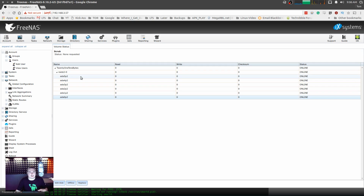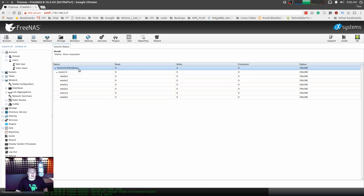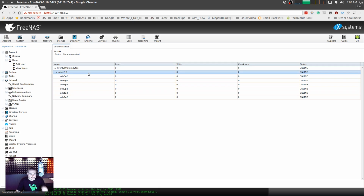Generally, when I build these, I build out all the drives I'm going to put into a system, and it's going to run for years until it's time to replace or upgrade that system. Now, you can add, this is just one set. If you have like 3 more, and this is what we did in our machine, we put in the 4 drives. Later, we added a few more. We have more expansion, or you can get a card, like a PCIe card, and add more drives. So you can add another volume. You just can't change the existing volume. But easy solution, copy everything from the original volume to the new one, then remove it, and now you can have the same system. Later on, swap out bigger hard drives to it.